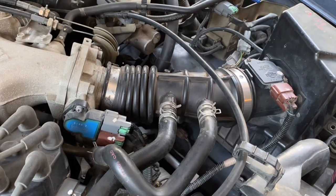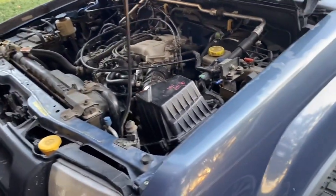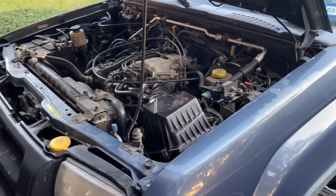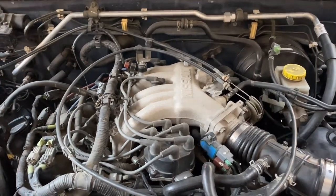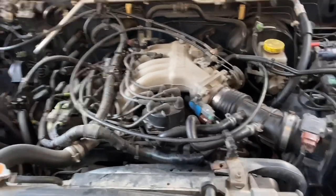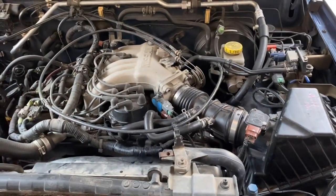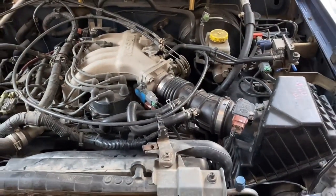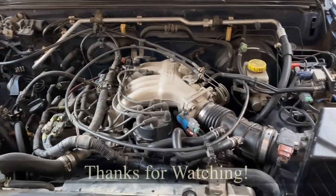So there it is. We're going to go ahead and drive it to work tomorrow and see if it behaves the same way. Usually what happened on a cold start is it would stay at like 2000 RPMs and it wouldn't go back down. Now I think it's going to go back down. If this doesn't fix the problem, we're going to locate the idle air control valve — IACV — and see if we can clean that one out. Hope you liked this video and hope it helped some people out on how to change your intake boot, clean your throttle body, and disconnect and reconnect any of this stuff. If you like this stuff, go ahead and subscribe to my channel — I make these kind of videos all the time. We'll see you next time. Just fix it myself.